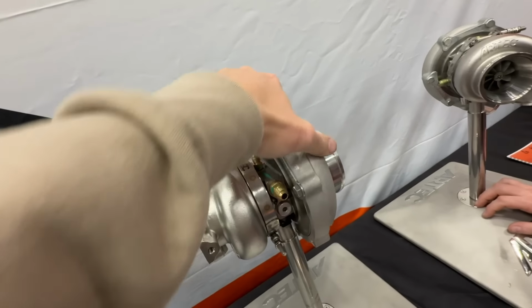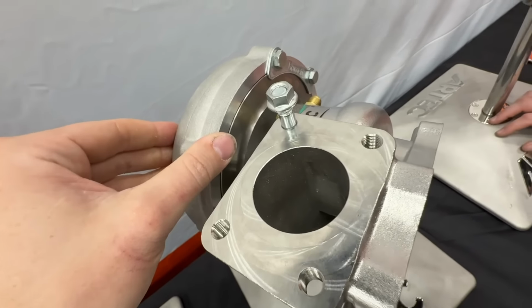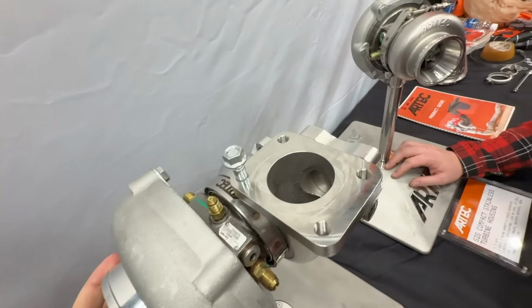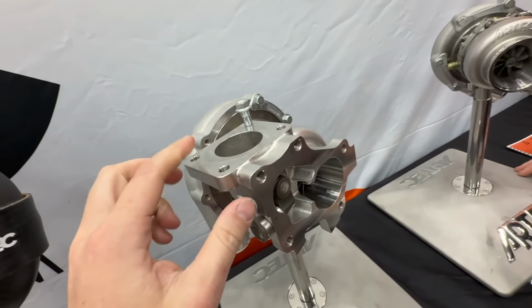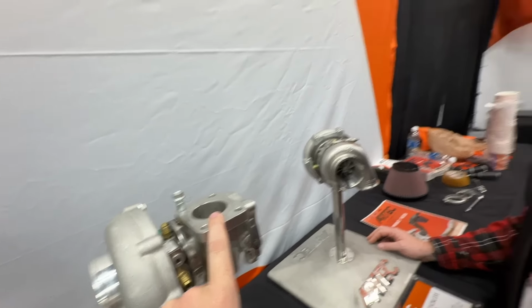So G30, big old boy. But do you recognize that rear manifold flange? Think long and hard there, Grit. Is that an SR? It's a 1J. Oh my God! It is a 1J. How sick is that? It's a 1J VVTi. Exactly. So he just came out, or I guess it's about to come out. This is a hot side to run a G30 on a factory JZ manifold.